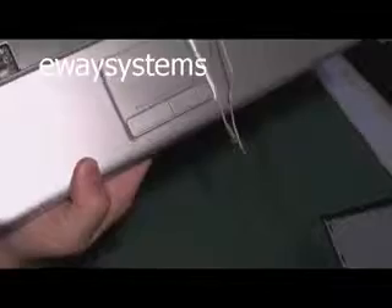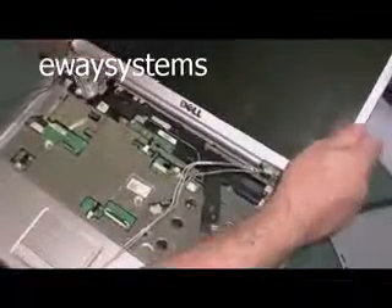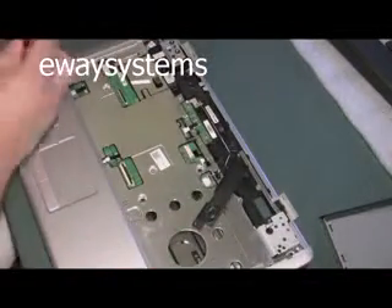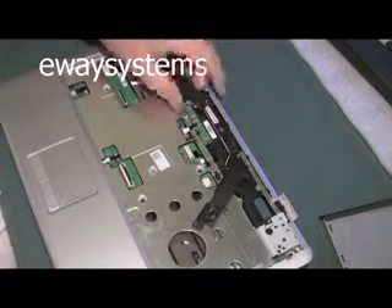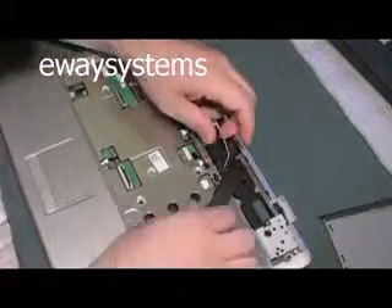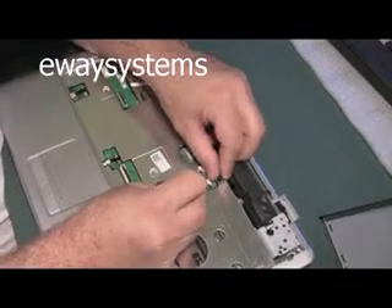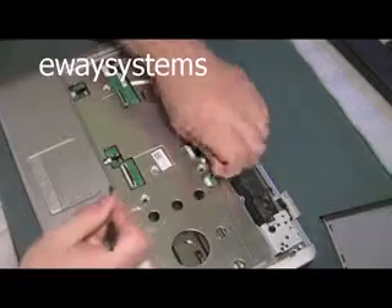There might be some other screws holding it in — check the back. Nope, it just had to be pulled off a little bit. Now that we got the screen out of the picture, let's get this other speaker off here. The problem is as these computers get more new and complex, they add more and more components and they're getting into tighter spaces. It's held on by a piece of black tape, going into the motherboard through this connector — slides right out of there.